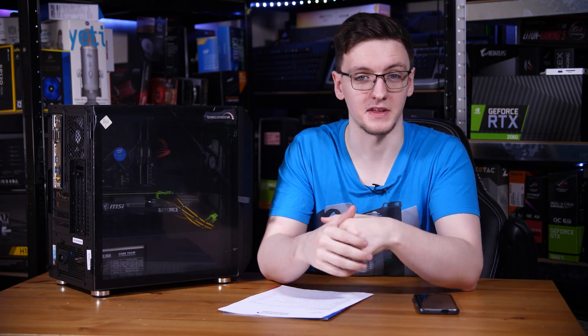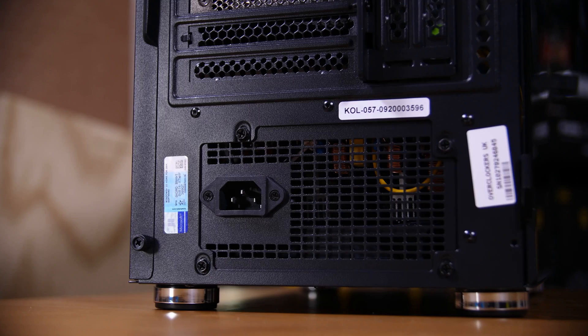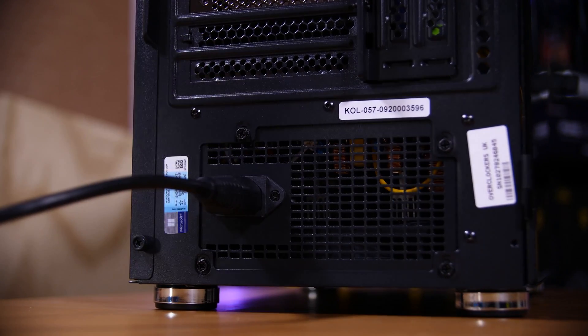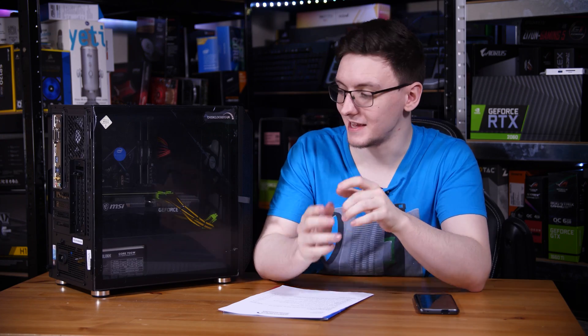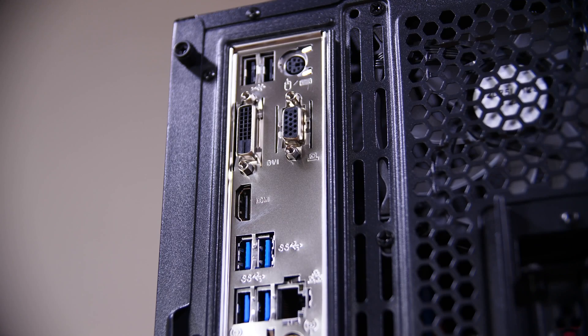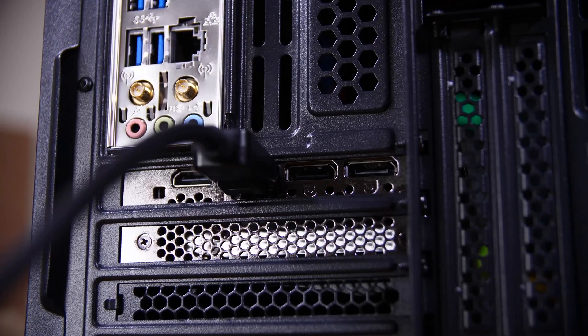To do that we need to connect things like power, display, keyboard and mouse, and any other peripherals you want, plus internet depending on how you want to do it. Power is at the very bottom - it's the three-pin connector, often called a kettle lead, and that plugs in only one direction. You will also want to connect your display by connecting it to your graphics card, which is the port in the middle of the system. You may have display options like an HDMI port up at the top by your USB ports, but don't use those - if you do you won't be using your graphics card and won't be able to play games. Make sure you plug into that middle slot where your graphics card is.